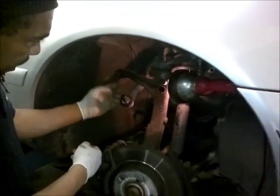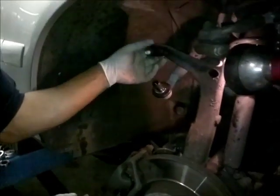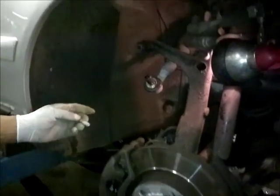That should be roughly where it needs to be. Now I've got to take it over here, get my steering up there and screw that back in - up to where my nut is. Once I've got my track rod end on and screwed back up to the nut - it's not tight yet - I've now got to get this bolt right in through here. This bolt goes through there but it must also line up with there, so I'll get my grips on here.